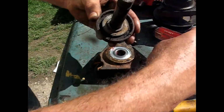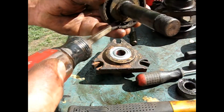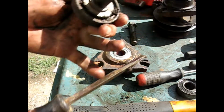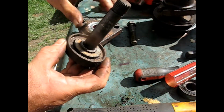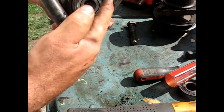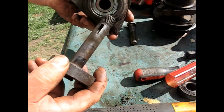And then as far as cleaning up stuff like this, the blade would go on this side. Just clean out this little groove here. A lot of times there's a lot of stuff that's been spinning around on your blade for years and years. Just get that clear again. Okay, so now we can see that part's cleaned out, and this part here actually goes over that just a hair, so you do need that clean, otherwise you'll probably just create a bunch of heat. If you had a bunch of friction between the bottom surface of that and this, or the sides, inside, outside, whatever, that'd be a problem.